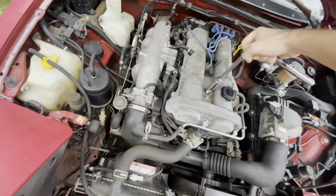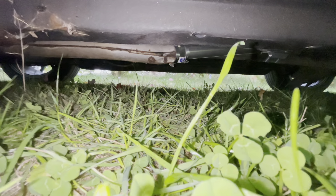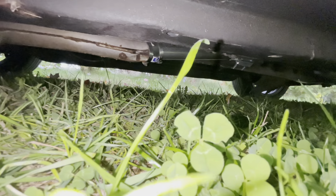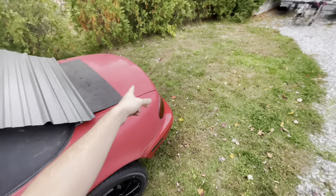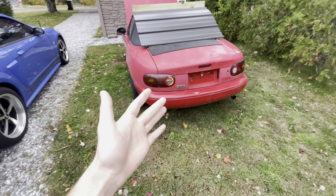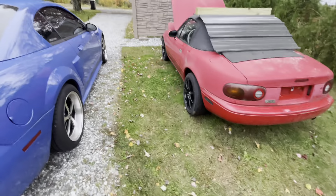The cat is apparently cut out. As you can see, there's like some soda can with hose clamps or something holding the two pieces together right there. So he gave me a mid pipe — I guess it's in the trunk — and I'm going to have to weld it because the flanges for the cat are cut off as well. So that's going to suck.